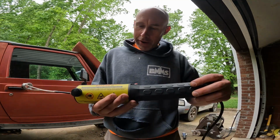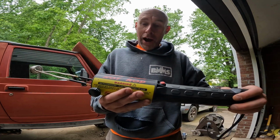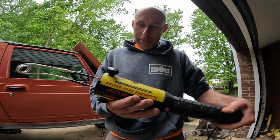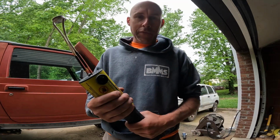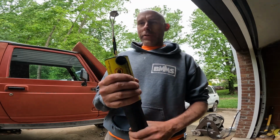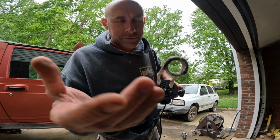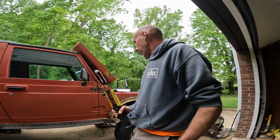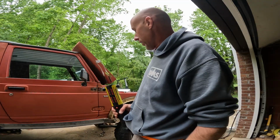But a buddy of mine let me borrow this induction tool here called the Hot Rod Flameless Heat System, made by Solary, and I'll include a picture of the serial number and try to find it online for you guys, and I'll put that in the description. But the idea is you put the head of the bolt through this coil here and it'll heat it up, and hopefully the heat will loosen up the bolt enough to not strip the head when you try to remove it. I've already tried a couple and it's worked out pretty well.